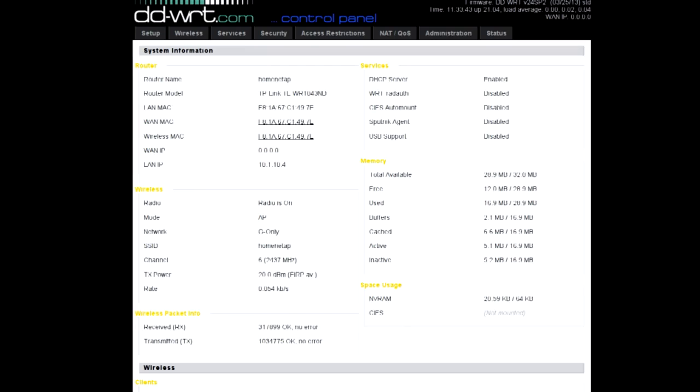You upload the DD-WRT firmware. There's a specific one if you're flashing from factory, so you really need to pay attention. I'll link a guide, but this part varies depending on your router, so I can't give you a catch-all guide. You upload this firmware to your router. It goes through a regular firmware upgrade process, like the router thinks it's upgrading to a stock firmware. It reboots the router, Bob's your uncle. When it comes back up, you're running DD-WRT.